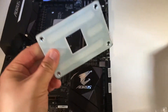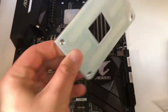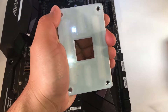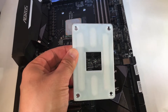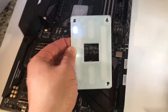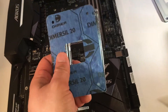I've removed the default back plate — this is technically the Evo back plate, although the original back plate looks very similar to the K7's. What I did, because I faced issues with booting, was take the original adhesive pad that came on the back of the K7 and stick it onto the Evo back plate, which works just fine. A lot of the issues people have had with getting their machines to boot due to the monoblock and the gaskets are pretty much resolved now. EK's new gasket is much thinner, and I will be using this and installing it into the back of it.